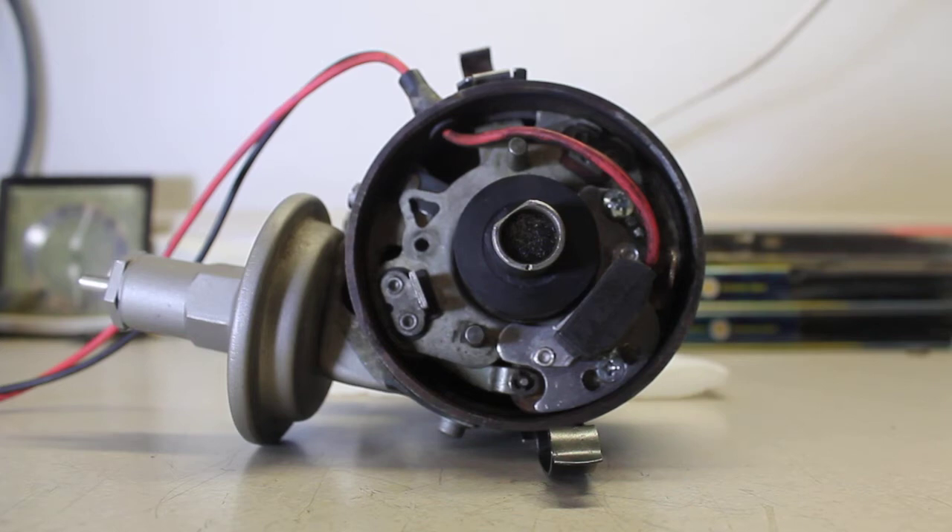It may work okay with that, but then again it may not. Particularly with generator-equipped cars like the 300E or 300F — if you've got the headlights on at night and come to a stop, the engine could die because the voltage goes too low. That's a problem.